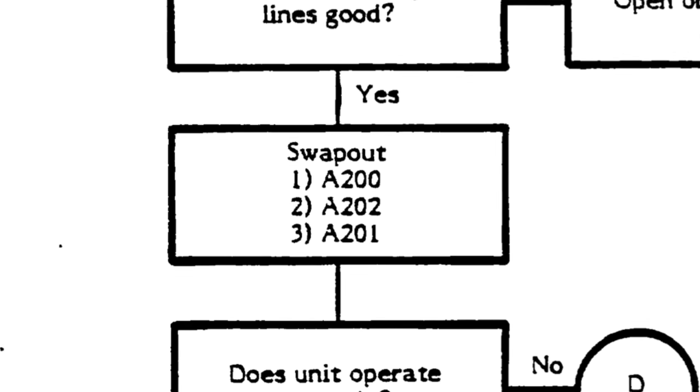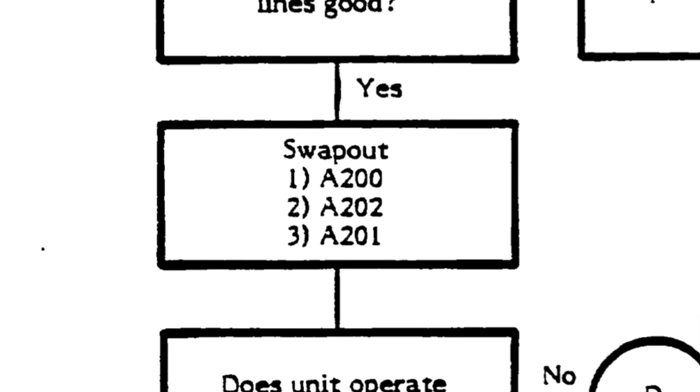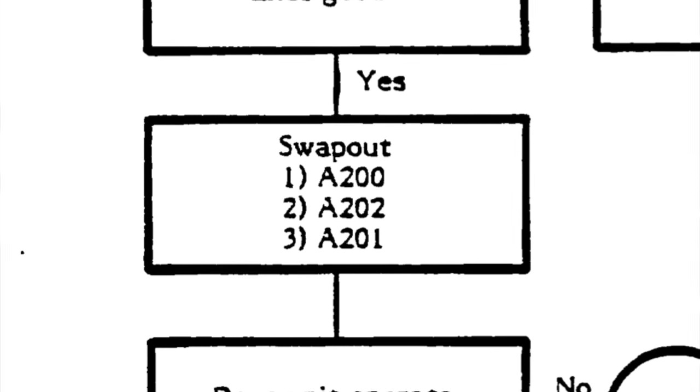And all of this leads the Atari flowchart to recommend swapping out the three chips, the RAM, processor, and the TIA chip. Stands for Television Interface Adapter, doesn't it? Yeah, actually, it does. And I reckon that that is the most likely cause of this right mucking fuddle.